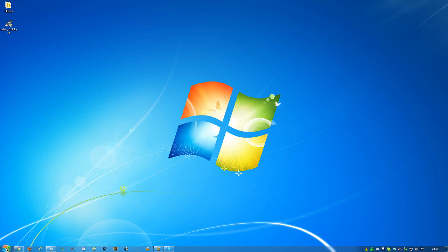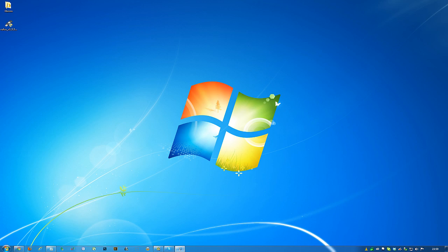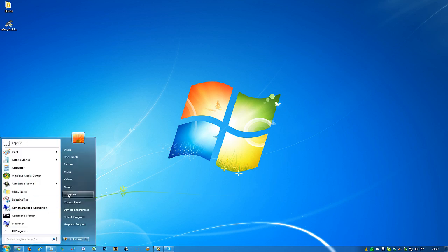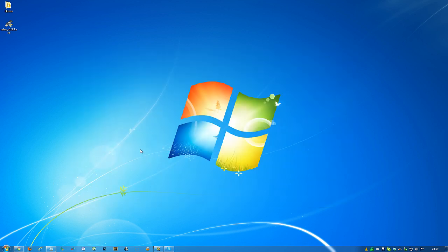Once it's finished, all you have to do is hit Close — it really is that simple. Let's double-check: going to My Computer, and as you can see you now have a Hiren's Boot CD on your USB. To actually use it, you will need to change your boot priorities to boot from USB first. Do that, and once you boot in, all the tools are yours.